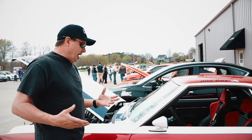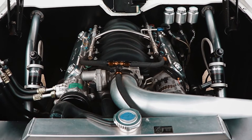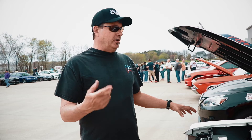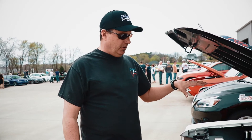When we built the car we added a lot of other things as well. We put in a super high performance cooling system, so it's got an oil cooler and a big giant aluminum radiator. We've also got an AccuSump system in order to keep the oil flowing through some of the big high-speed turns and keep the LS3 oiled up.